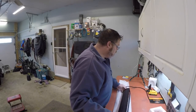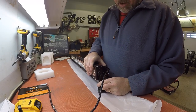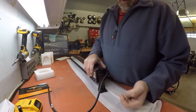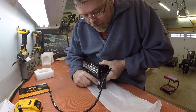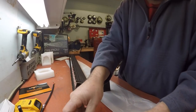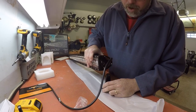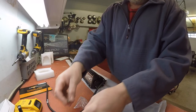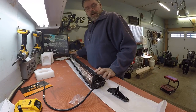Just going back to the brackets — the brackets are simple. You just go on like that, put your screw in there. It all depends on how wide your rig is. You can put them this way — if you do it that way, nobody can just take out that screw and rip them off as easily. I would mount them on the light where you're putting it, then take a pick tool and mark in there, drill your hole, pull them off, put them on. Make sure you put in your rubber grommets in between — stops vibration. It comes with two bolts to bolt it to something and also two that go inside. The brackets go on and Bob's your uncle.